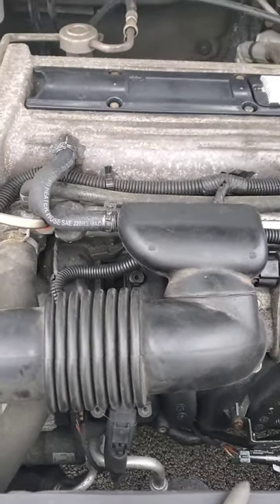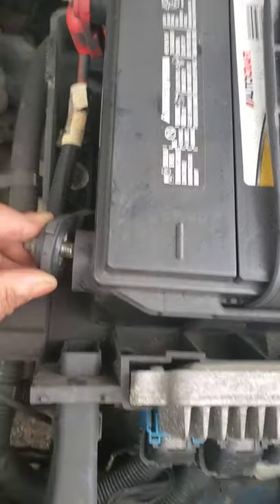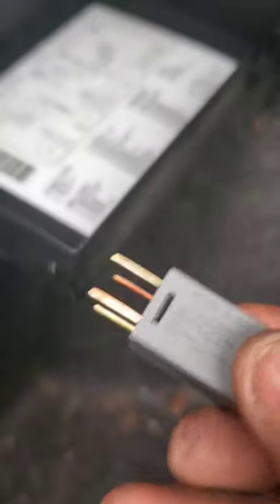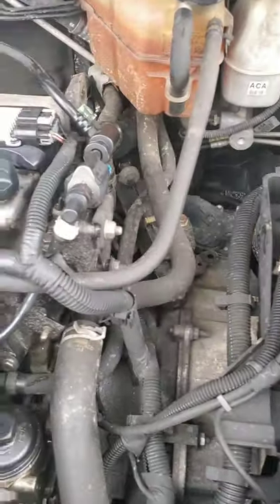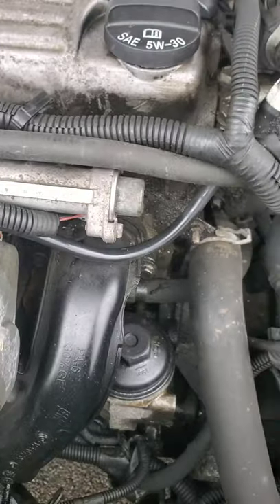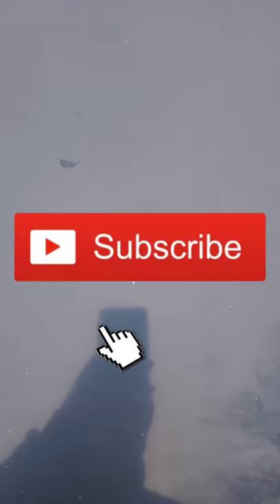I'll put the hose on — I'm going to have to trim it down a little bit later, but this is fine for right now. Connect the negative terminal to the battery and tighten it up with an 8-millimeter socket and ratchet. Go back in the trunk and replace your fuel pump relay, close the box, and make sure it's all the way in. Put your battery cover back on, then give it a start. Make sure you have no leaks around the fuel rail — check it really well while it's running. And that's how you change all fuel injectors on the 2005 Chevy Malibu 2.2 Ecotec engine. Thank you for watching, have a wonderful day.